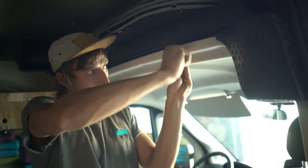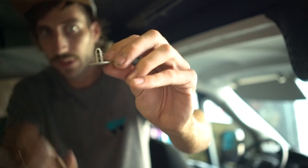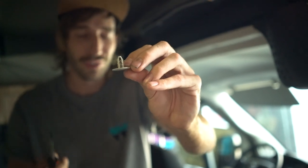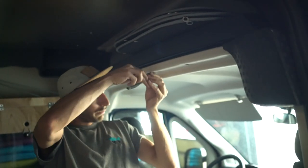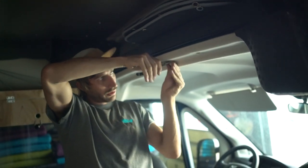You'll hear it popping. I'll show you this one because the other one got away from me, but it looks like that. There are ribs to it so it compresses, and you can use this also to install your partition, which I'll show you in a second. The last way to get out your rivet is with a pair of pliers — you can just grab the sides of it, leverage it out, work the other side, get it out.